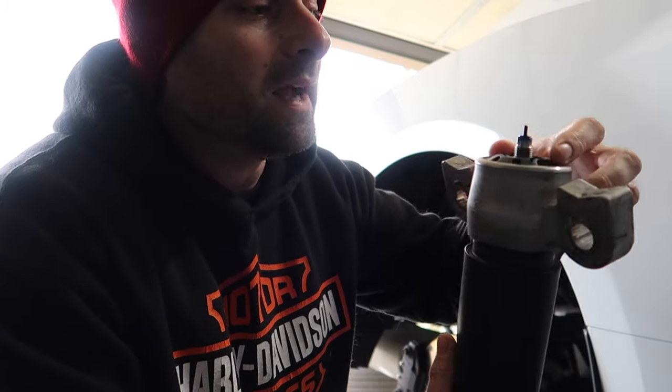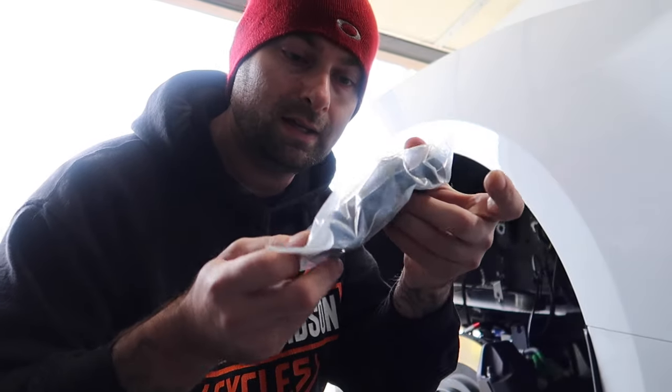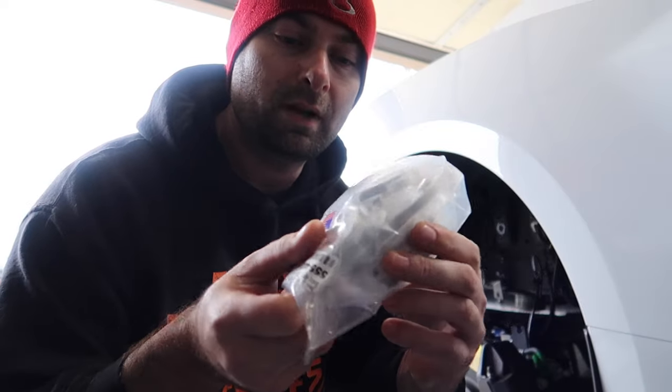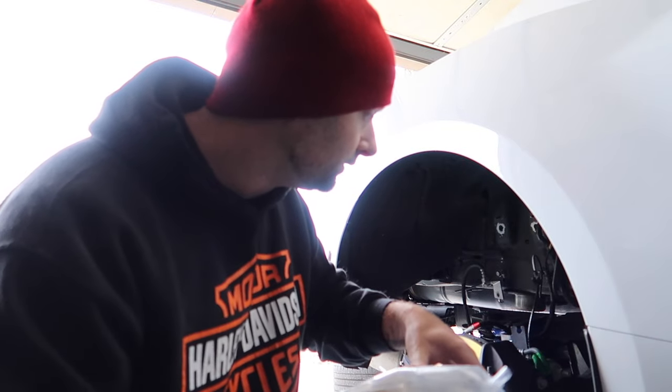Basically what happened is as I was drilling through this piece, it got so hot that the rubber actually fell out, which gave us this unwanted play. I love the way the dual rates sat on the car - the front end raised just a tad but the rear end came down, so we want that perfect stance. I've also got their subframe alignment kit and their bushing lockout kit. I didn't get the big arms yet - we're going to do all that later with sway bars - but since we're back here dropping the whole independent rear suspension, it makes sense to do this all at one time.